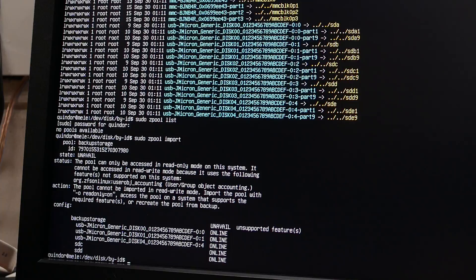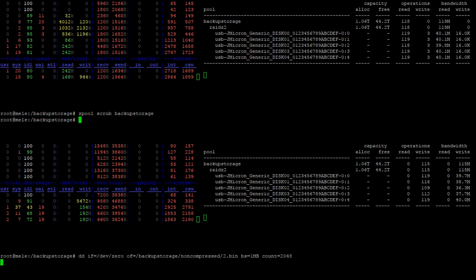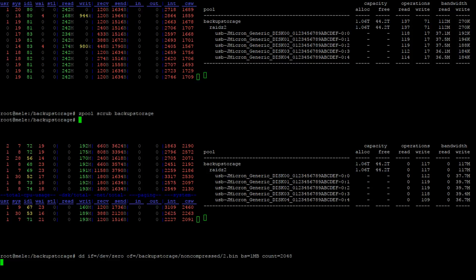I'll be using this system with ZFS and I've done extensive testing. This is me moving the array from my testing system to this one. On my test system I set up a RAIDZ2 of 5 times 10 terabytes, filled it up with random data, and then did a complete scrub. It took about eight days in total — filling up 30 terabytes and then reading it back again takes a while. It came back with zero read or write errors and no checksum errors, so that works well.